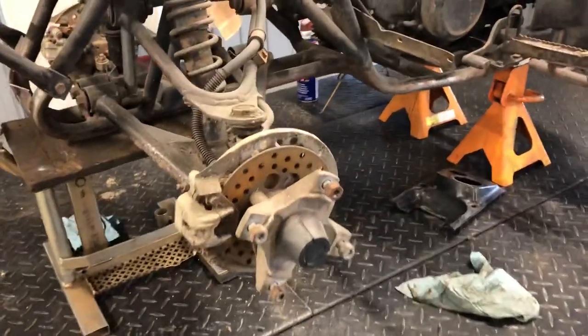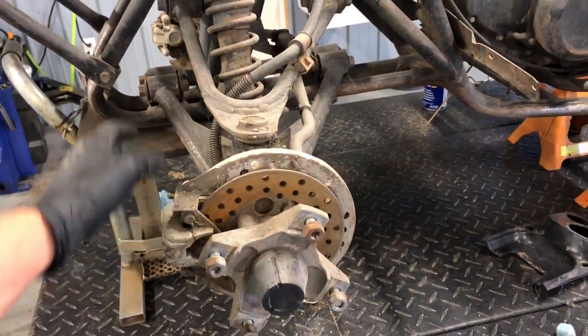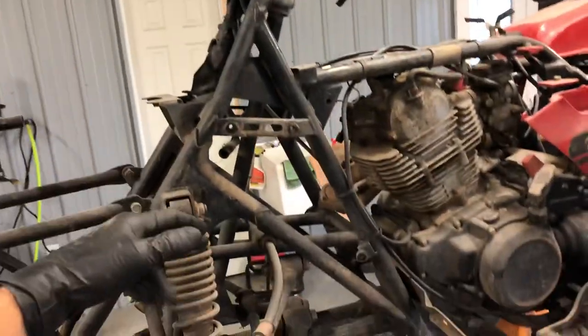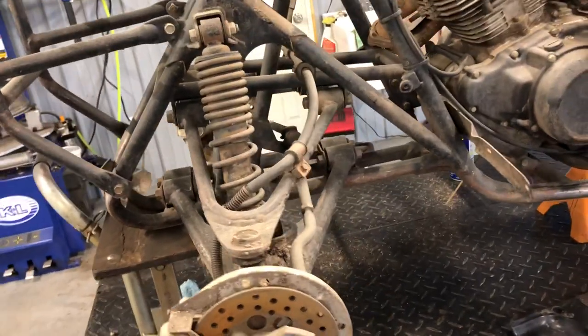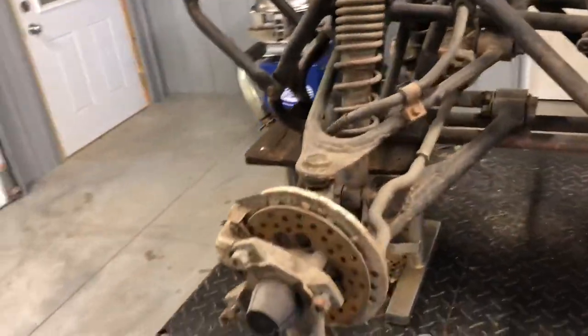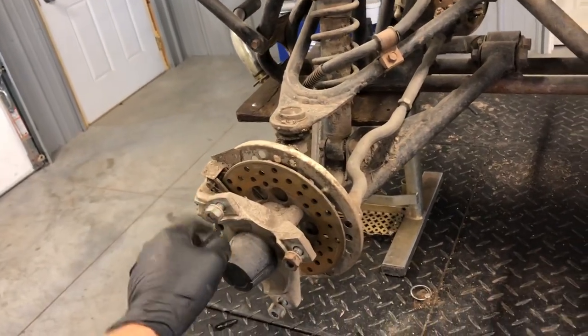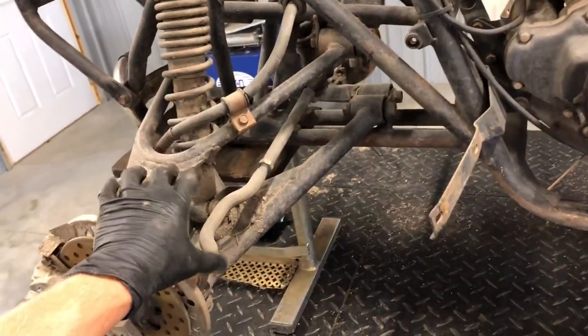This has got the disc brakes set up here — hydraulic calipers. They run down from the handle up there, run down and then split to each caliper, and that's the front. We've got your hubs here. We've pulled these rims off. It's a 17-millimeter nut there. Front shocks. We've got the upper and lower left-hand A-arm on this side.